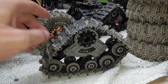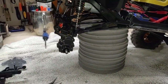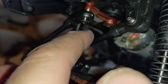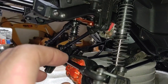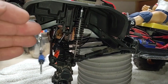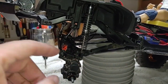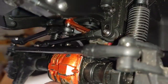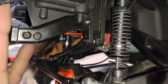Make sure to check out that video if you haven't seen it - tracks versus the 2.2s. The entire run my servo horn was rubbing on my panhard bar; when I got back, all the paint or marker was rubbed off right there around the corner. I recoated it with a Sharpie - that's a nice thing about Sharpies, easy to recoat. After figuring out our suspension geometry and putting our servo back in its factory location being mounted from the top down, we've got full suspension travel once again. We can fully compress our shocks and our panhard bar is not coming anywhere near our servo horn.